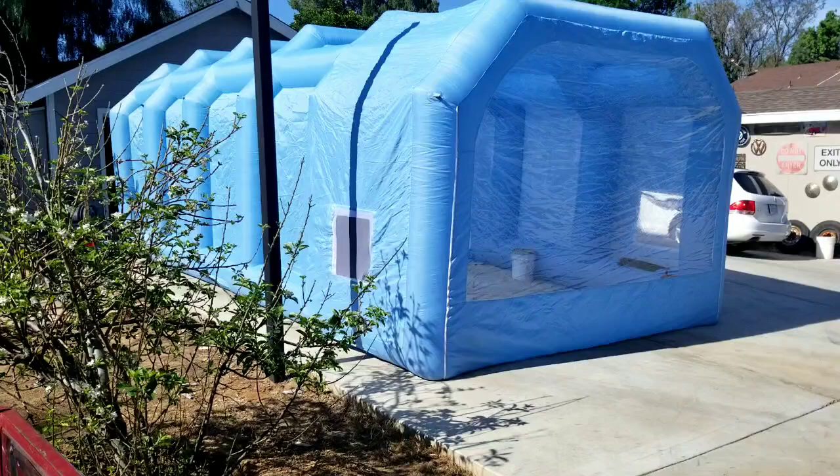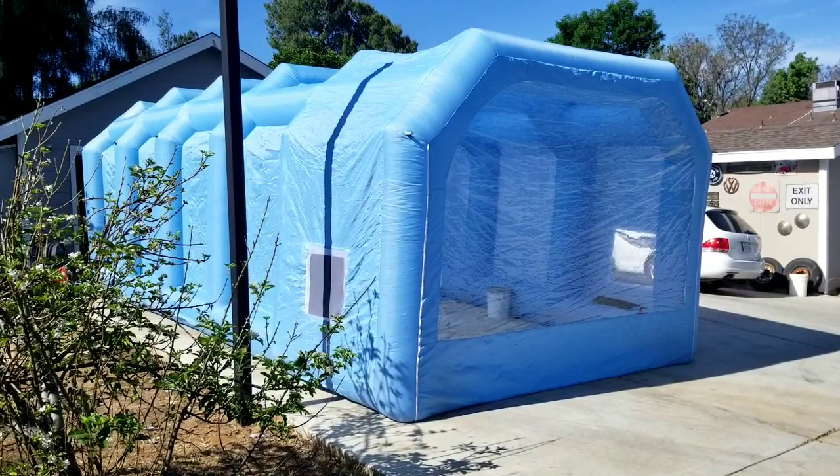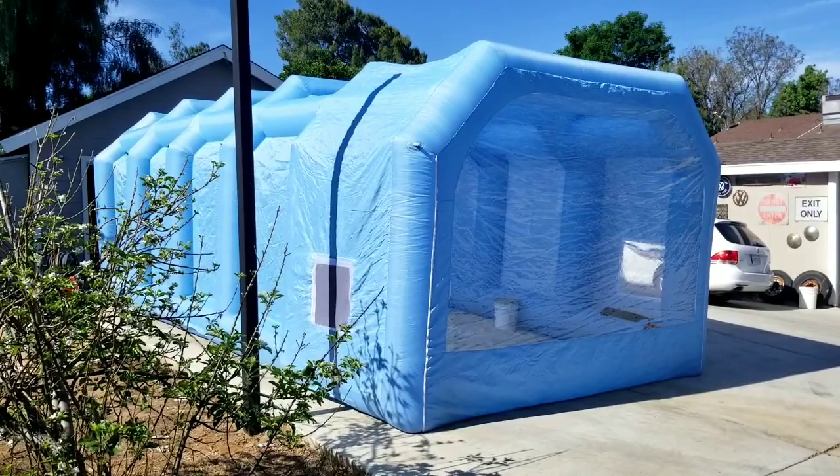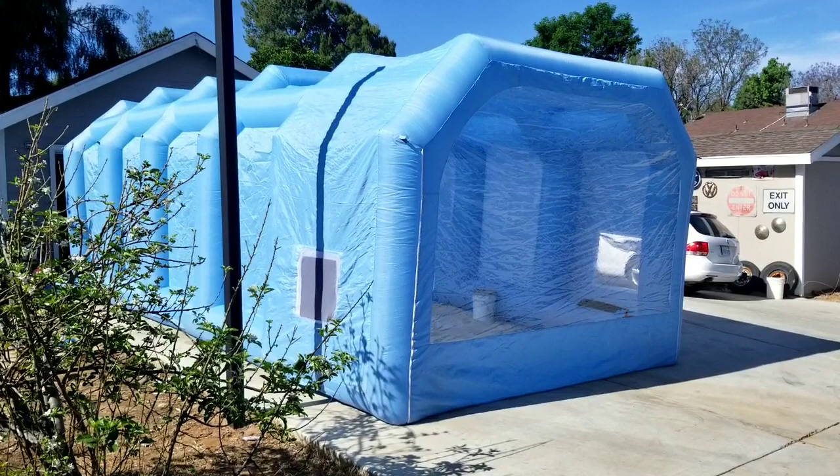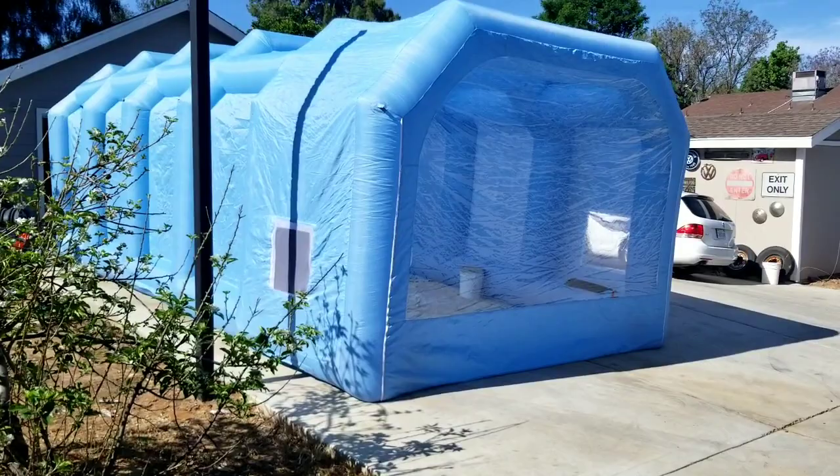I didn't, because I was using a really slow hardener. And it was 100 and something, probably 110, when I sprayed in there. So you've got to have a good clear. If you have a crappy clear that doesn't flow out and has a slow flash time, that's an issue, but the flash time was right with the Tamco. So anyway, a couple ideas. Talk to you in the next part.